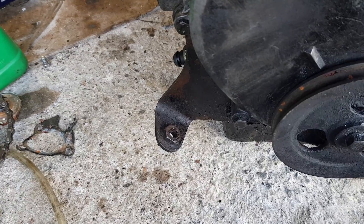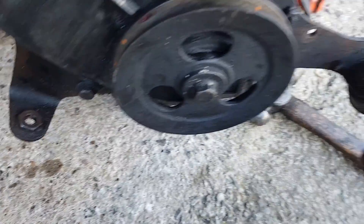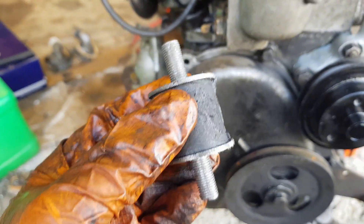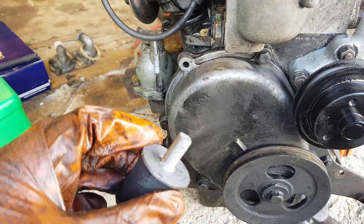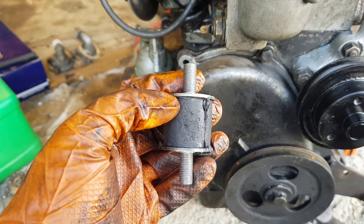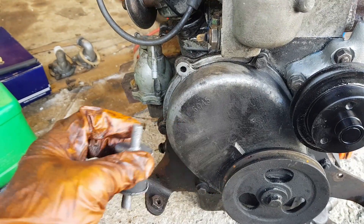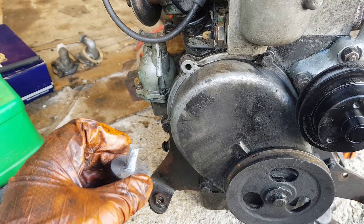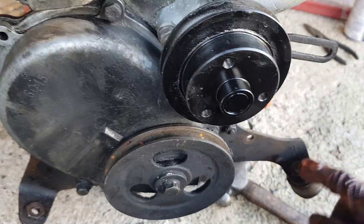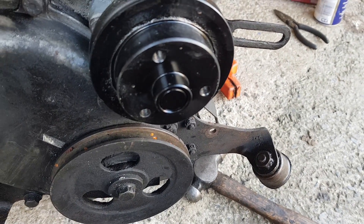Just realised we've got another problem here. We can't have a captive nut on both sides of the mount, because otherwise how do we tighten the mount up? It's captive into the chassis, which I think is different on the Fox compared to the Robins — having a nut and bolt through the chassis which is fine because you just screw the mount on and then bolt it through. So I'm going to have to cut these nuts off. I'm not going to spend any more time fighting that one — I'm just going to get the angle grinder out.